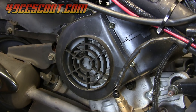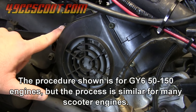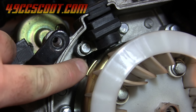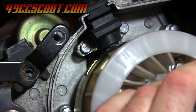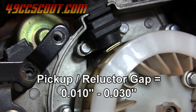Since I've found a weak signal coming from the pickup, I want to take a look at it. I've got to take out all of these six millimeter bolts with an eight millimeter head and remove this side cover. I'll measure the gap between the reluctor — the raised part on the flywheel — and the contact in the center of the pickup. I'll rotate the engine so the reluctor aligns with the pickup. The gap should usually be a minimum of about 10 thousandths of an inch and a maximum of around 30 thousandths of an inch. You can check the maximum using a credit card, which is about 30 thousandths of an inch thick, or use feeler gauges to find the exact gap.